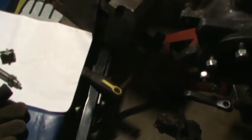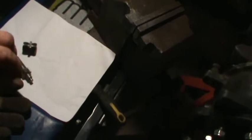Alright, so to make the Toyota speedo cable work with the new Process 205, that's from the late 70s or whatever. Here's the Toyota speedo cable. It had a round end on it, but a 1/4 inch with a pinched spline that lined up, and that was what spun the speedo gear for the speedometer.